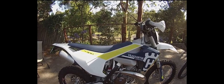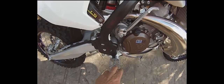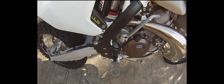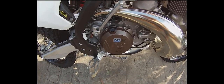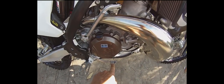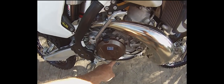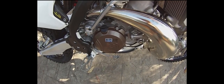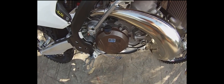Another minor change in this vicinity of the bike is the footpegs — they now have less serrations and more of these pimples. I'm not sure if they're supposed to hold less dirt; we'll see how that goes. Also the brake pedal — I'm not sure if it's 10-15mm longer — and they've also changed the brake tip. It has more of these large pimple designs rather than serrations, and they've changed the tip design itself. On the earlier bikes it was always recommended to file off the inner teeth in case they damaged your clutch cover if the bike fell over. They've taken heed of their customers and now have a neat little loop with a chamfered edge, so hopefully that should reduce the chances of damage to your clutch cover.